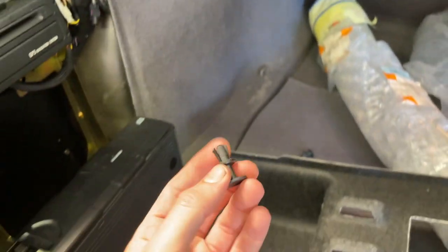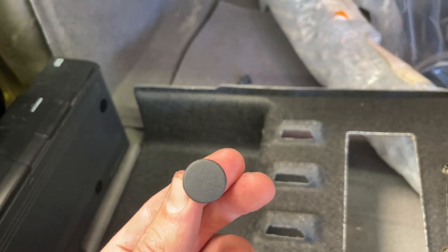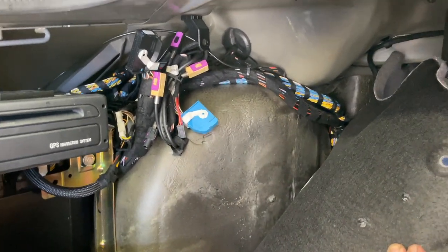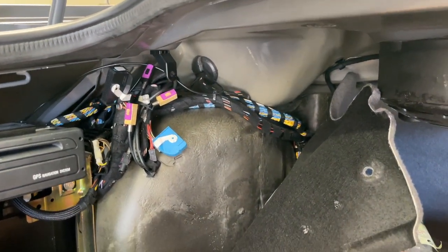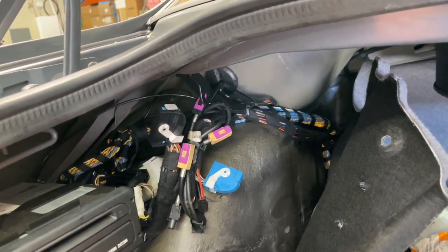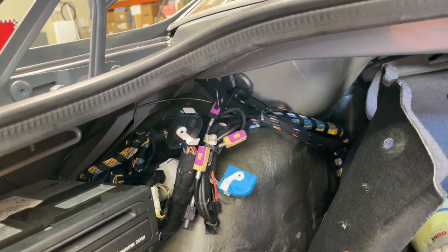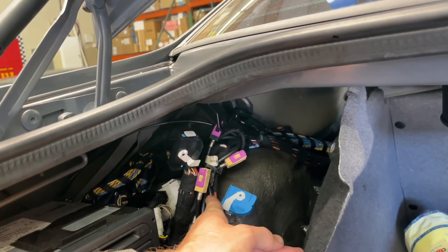To gain better access we can remove or loosen this side of the carpeting. That is done by removing this little pop rivet — that piece on the right pries out. It's a plunger that must first be pried out with ideally a pop rivet removal tool or a flathead screwdriver, then the whole thing comes out. That will allow you to peel back this carpeting and get a perfect look up here. We're looking in the area on top of the rear left driver's side wheel arch. Normally all these wires will be bundled up and held with a zip tie. Sometimes, depending on who put the car together, you'll have a big piece of black sticky cloth-like material hiding all of it. It's just in a big black ball — that stuff's real sticky, so maybe put some gloves on or go in with a knife, being very careful not to damage the wires.